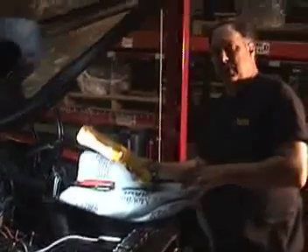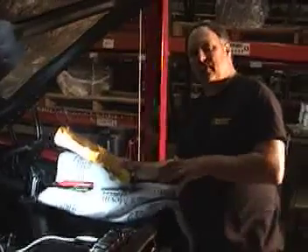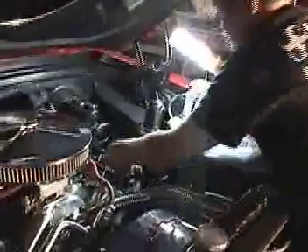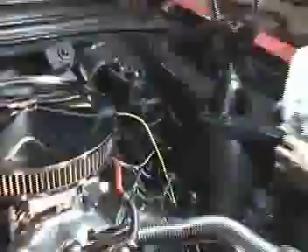One of the things that we found when we were dealing with this car is we found a lot of cuts and splices. This car was a real mess. We're going to make this good and safe for the customer. We started removing our original harness here, and you can see all this electrical tape and all these wires that are all cut and spliced. We've got some other wires here that we don't even know where they go. We've got some other wires down here running through a grommet in the firewall — we're not sure where those come up. We started pulling this away and found a whole new set of issues. If you look at all the cutting and splicing going on here, we've got this little safety wrap here — whatever that is.